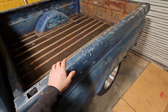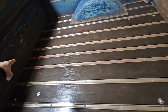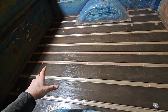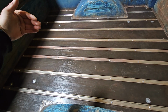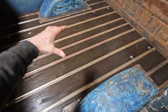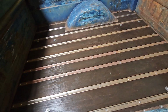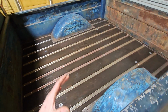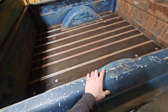But one thing I did notice was, because this truck is an X frame, it's got these bars like a part of the frame that comes across like an X, coincidentally, right? X frame. So I'll have to brace off of another angle, and from what I'd read, you want the brackets from the Barnes site would put it at I think it was 22 degree angles this way. So then you wanted around 40-degree angles, which would keep the rear end centered, and you wouldn't need a panhard bar and whatnot, which is kind of what I'm after, is just to have a triangulated 4-link, so then that keeps the rear end under the truck and I don't need a panhard bar, and then we use the coilovers to hold the weight of the truck up.